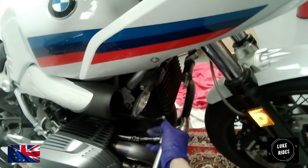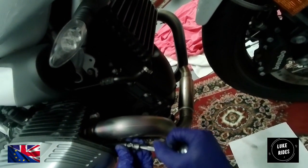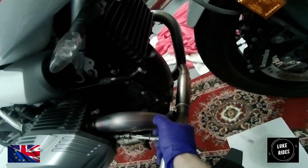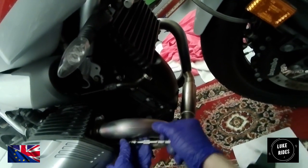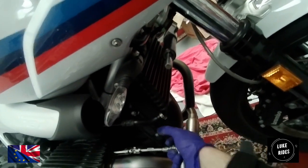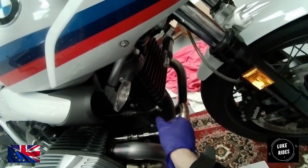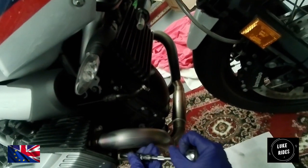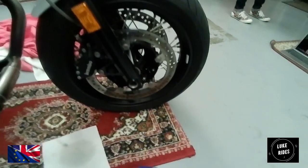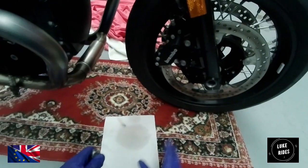Okay, the flange is just starting to get tighter. Now getting nice and tight now, real tight. And again, you're trying to apply that torque down evenly, which is good. You can actually hear the crushing taking place now. I'm waiting for the ratchet to click, like so. Okay, great stuff, click twice. Usually what happens is if you click a torque ratchet twice, it's just confirmation that you have hit the torque dead on.